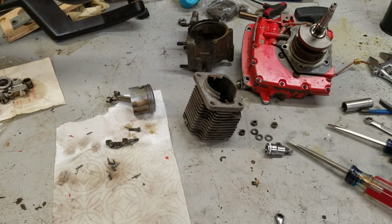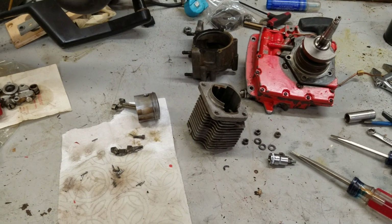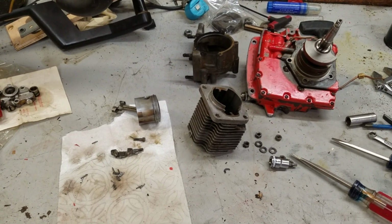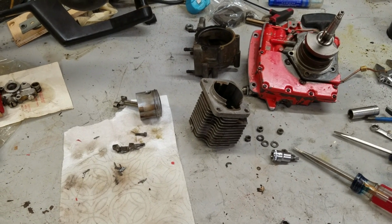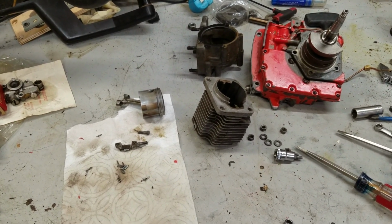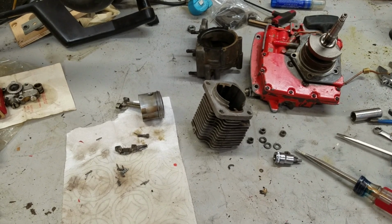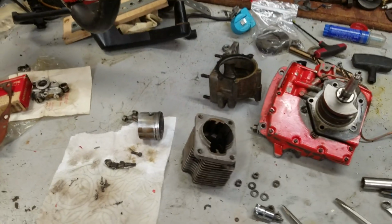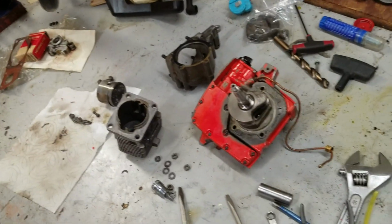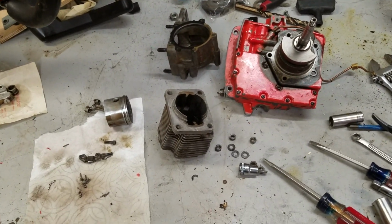Now, that's not for everybody. I understand that. But your good quality mixes from Stihl, from Husqvarna, there's others out there, all kinds of them. I'm not talking about the Walmart, $4.99 special. But there's no reason that these saws can't run at least a 32 to 1 mix. And when you're pulling the trigger, if you're getting a massive burst of smoke, you're running way, way too rich. It should be a light haze, if any visible smoke, once it's warmed up.